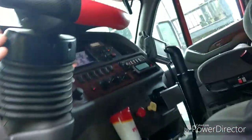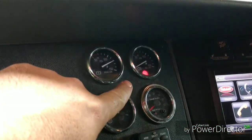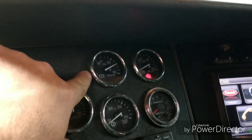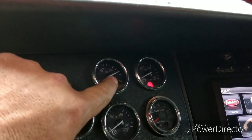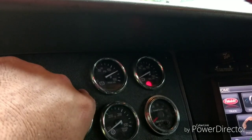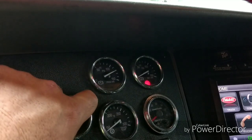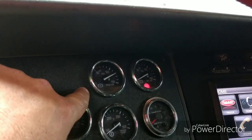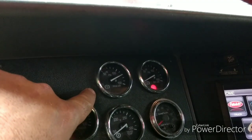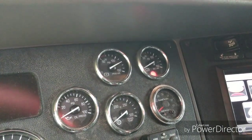So they come around inside the truck. Now, as you can see, we've got air in the primary tank, but nothing in the secondary. And I just aired this up until the governor kicked off. So, anyway, I've already gone around with a spray bottle of soapy water to check for leaks. And that's probably the best way that you can find air leaks on these trucks, is just a spray bottle with soapy water.